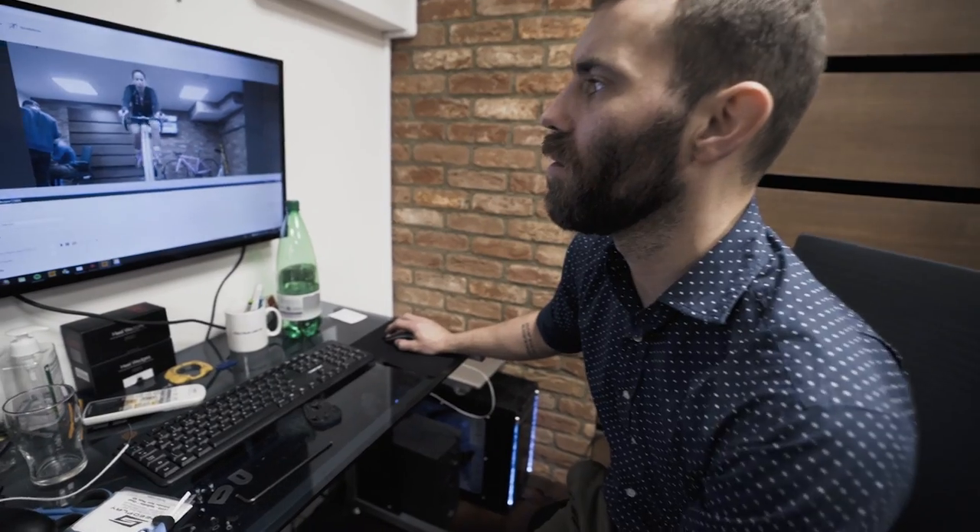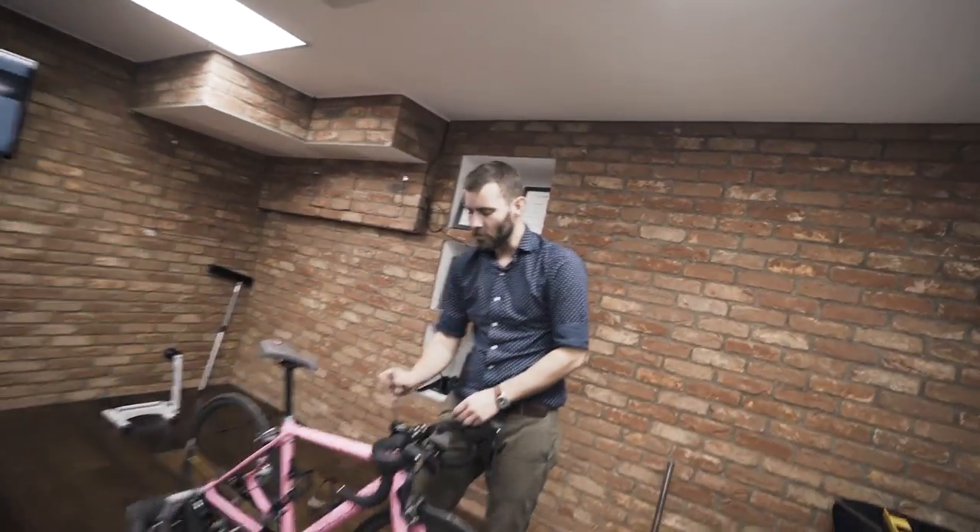James has made quite a few changes now, but still not happy — there's still room for improvement. He's going to slam my stem. I thought slamming stems was bad. No — slamming stems just because it looks good is stupid, but here's what I tend to find: people run their saddle too high, which pitches them into the front of the bike, so they bring the front end up to offset weight on the hands. If you lower the saddle height so you can reach through the bottom of the stroke, you don't get pitched into the front of the bike, so you can lower the front end accordingly. All I've done with Louise is lower 20mm onto the bike because she's no longer having to excessively point the toes at the bottom of the stroke.